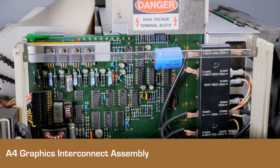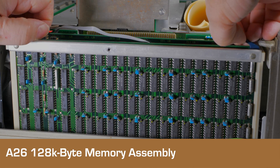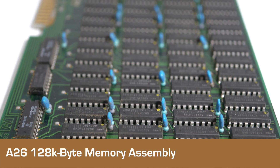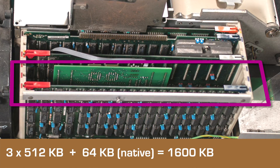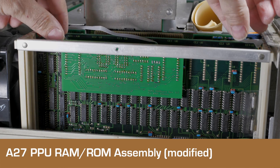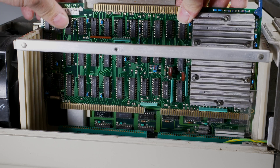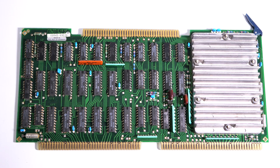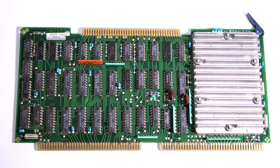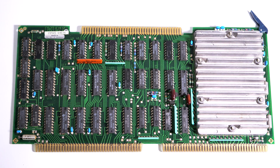This last device in the cage is an interconnect assembly bridging the underlying motherboard and this leg of the monitor. If we flip over to the machine's left side, the first three board slots are for RAM. There were a couple of different sizes; the first board on here in this Model B is usually a 128K. It's possible to fill all the slots with 512K boards instead, which would give you a roughly one-and-a-half megabyte RAM total configuration. The RAM and ROM for the PPU are in the next card back — these devices are also subject to bit rot, so you can see another piggyback board. And does that look familiar? It's a second hybrid processor board — this is the PPU, or Peripheral Processing Unit. It's the same actual processor part as the LPU, with its own dedicated RAM and ROM with a separate I/O-based operating system that cooperates with the language processor.